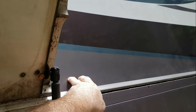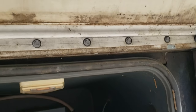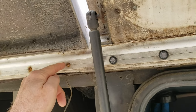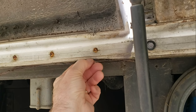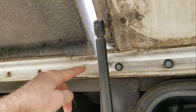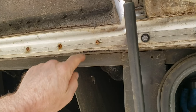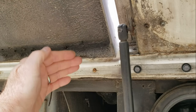This fiberglass comes all the way down to this level right here. Behind it is some Luan plywood. Water comes up from below and also drips down through there, seeping in through these screws — you can see how they're rusted. That water deteriorates the plywood underneath. See that plywood coming off? It's only rotten up to about right there; everything above that is okay. This rot is from water being splashed up from below. Since the plywood is rotten and the screws are very short, this hinge really is not being held on by much of anything.